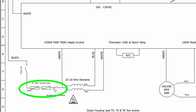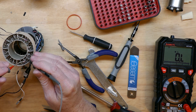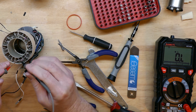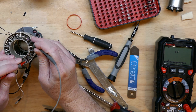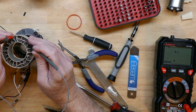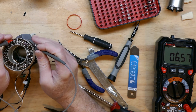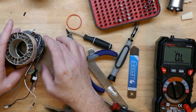Going back to the unit and looking more closely, we have the two thermal fuses right here. Testing across this first one — nope, that is not good. Between the two, connection-wise, yes, low ohms. Continuing on, this one here is good, and this one's good. So that's our bay of thermal fuses, and hopefully that's the only problem with this one.